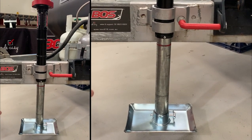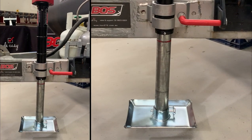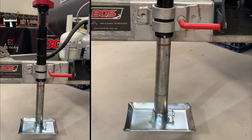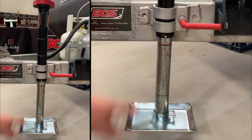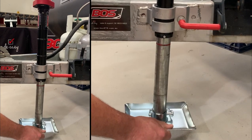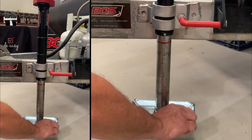What can also happen is you can lock the outer tube or inner tube all the way out, meaning you've hit the stopper on the thread — our units have a stopper so it doesn't run off. Now you're going to have to try and retract it, but because you rammed it so hard, it's basically like a nut and bolt system — so tight that you can't retract it, you can't undo it.